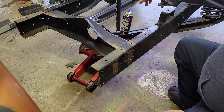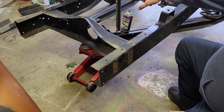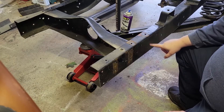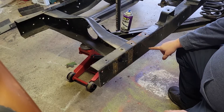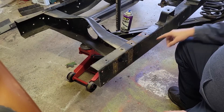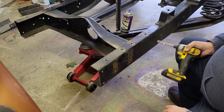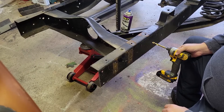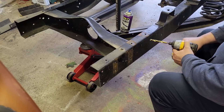I had the template up here and already got the passenger side rear cab mount mounted up there, fastened securely with the hardware. The template had me drill two one-eighth holes right here, and then I need to come back with a three-eighths drill to make them bigger. Once I get those holes made, I can secure my other rear cab mount here and just go from there.